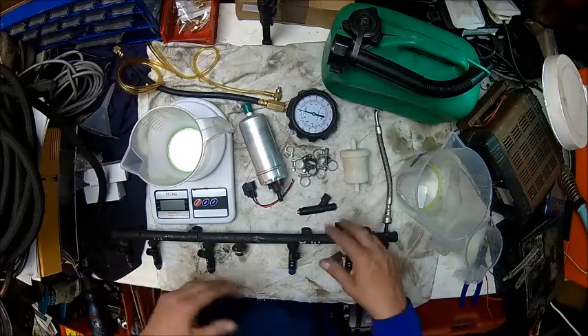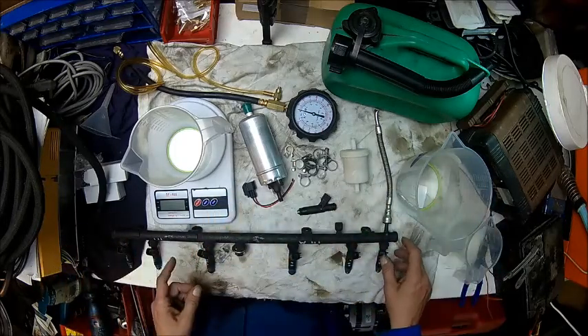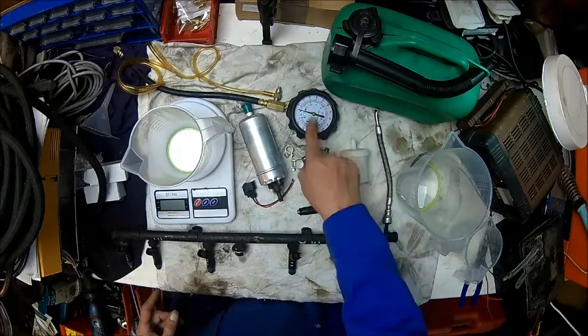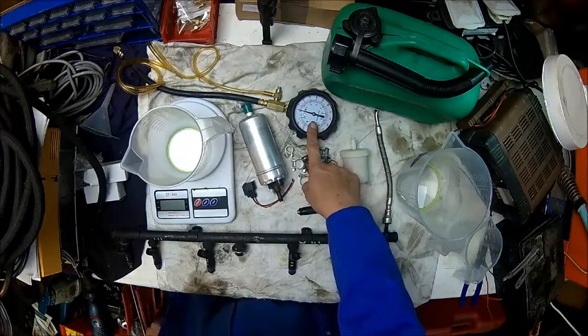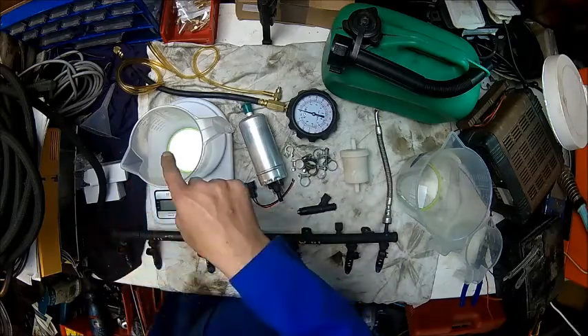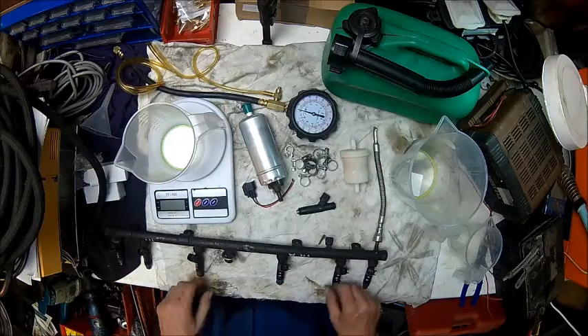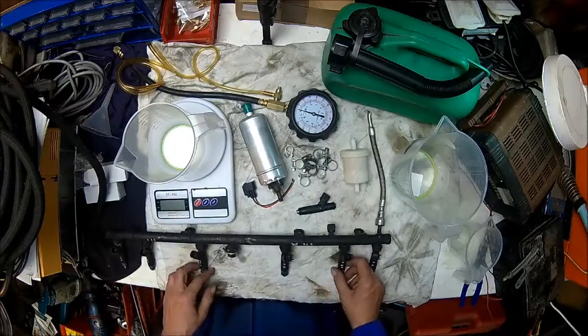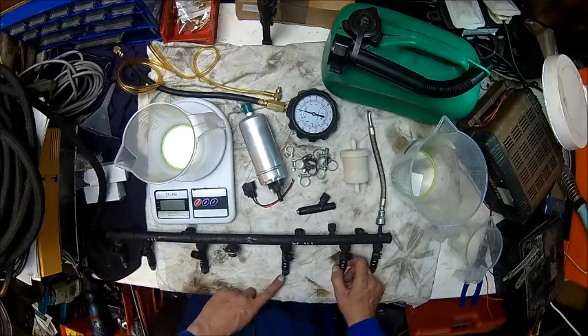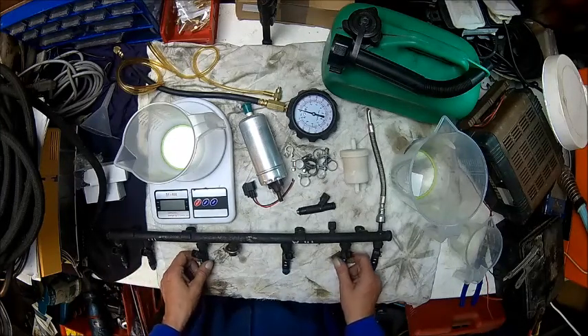What we essentially do is hook that all up - I do that off camera, just do all the pipe work, get the pressure to the rail, measure the pressure to make sure it's always the same, and then we leave it running for a minute and measure how much fuel goes into the bucket. I'm going to test at least two or three of those to make sure we have a similar flow. As long as the spray pattern looks okay, we should be okay - we'll find out.